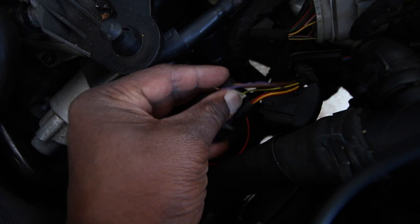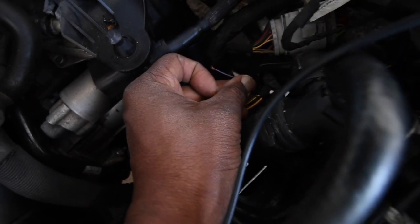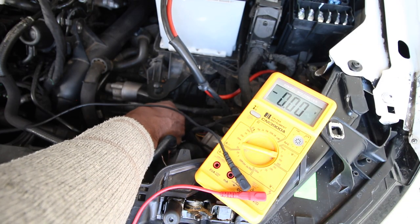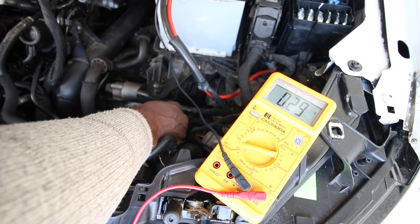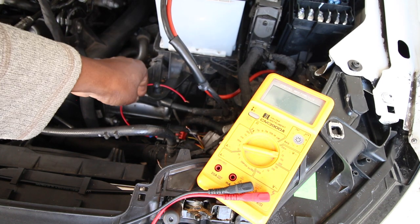That didn't take long to figure out - this cable here actually broke off at the end of the terminal. I'm pretty confident this is where our issue is. To prove it, I'm going to run some power through there, connect the multimeter, and we should register some power. With the red lead going directly across that cable, we are registering 0.29 volts - and that is the correct signal we should be seeing. This is definitely where the issue lies. I'll run a cable across to the fan and see if that solves the problem.